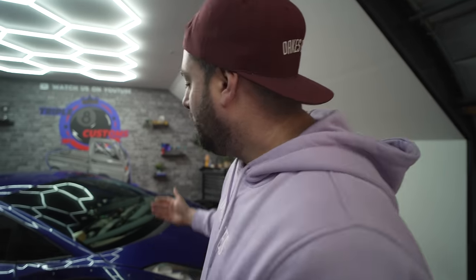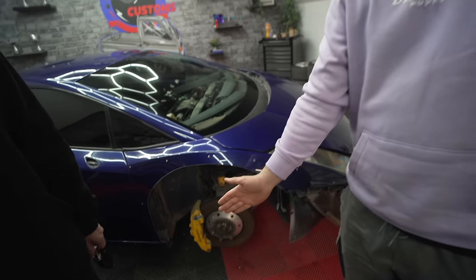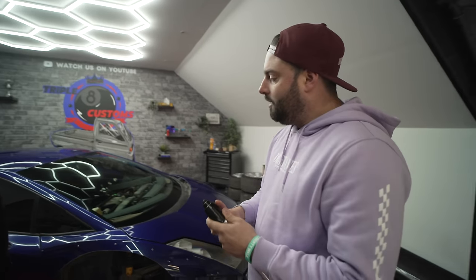Also, before you think this is going to get 90 degrees of lock, that's impossible with this car, because unless we were to move the wheel out to about here, we don't have the clearance. So we're going to try and balance clearance, wheel size, and Josiah's techniques, brains, and machining to make as much lock as we can get from it. Hopefully it's more than it had, because it had nothing. To be exact, this is going to be a 40% improvement over what it was.